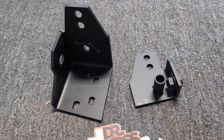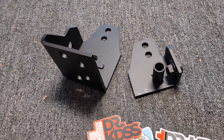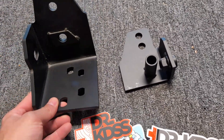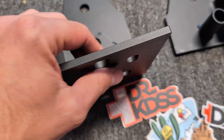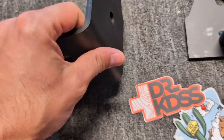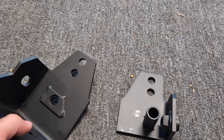This is from Dr. KDSS. Check out their website — they've got a ton of really fantastic parts for these trucks and all kinds of other vehicles. What people used to do, and still do a lot of times, for panhard bar position adjustment is weld a tab onto either the axle or the frame to adjust the location of the panhard bar to get the angle correct again. I've never seen these bolt-on ones before. Extremely thick construction, very well done, powder-coated in a matte black. Everything's welded really nicely — you can tell this is all bent extremely well. It's tough to get this thick of material to bend this nicely. The welds are really nice, really nice bead laid down. Overall, very impressed with it.